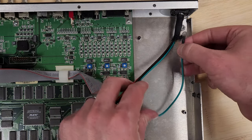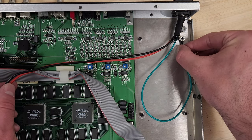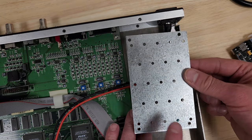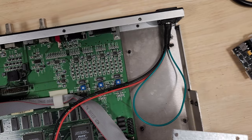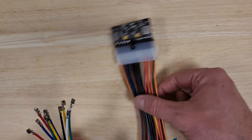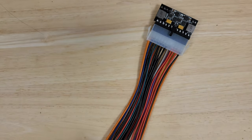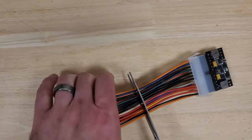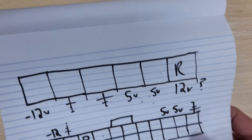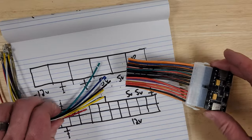I have to make a pretty tight angle with this barrel jack to get in there, so I'll install it floating under the plate I'm going to put in. Now I'm realizing I probably want to zip tie the PSU to the plate before I bolt it down. The game plan is to make six custom pins, make a custom plug to connect to the main board, then cut the ATX extender roughly in half so I can use that end someday if needed. I'll make sure to get some heat shrink on that.